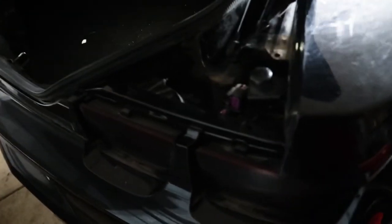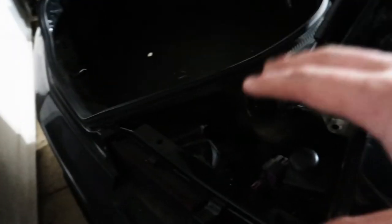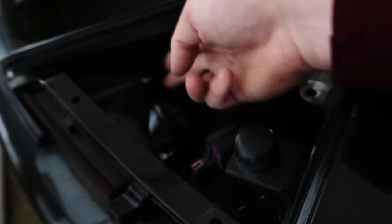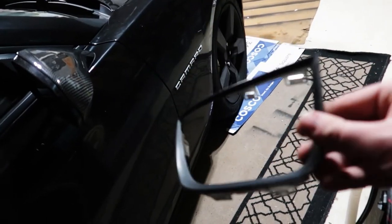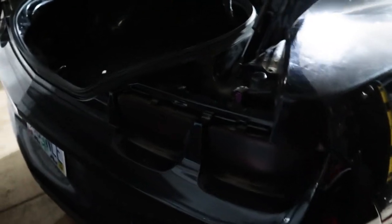I ran a backup camera in the last video so I already pulled both of these covers — there are a couple of push pins, get those out of the way, unhook your taillight, and then each individual light has three 10-millimeter bolts that come out. But before you do that, make sure you pull off your bezels. Mine look great, they're spray-painted chrome. Use a pry tool and slowly work the corners — they pop out pretty easy, more scary than it looks.